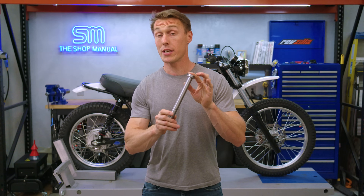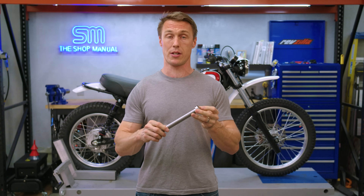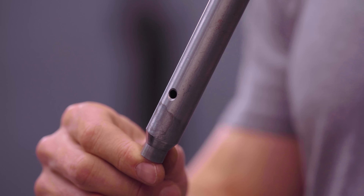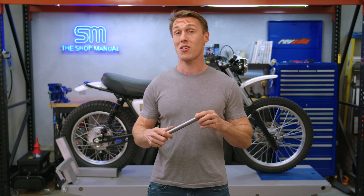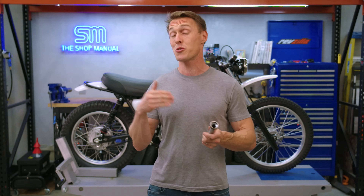This is a damper rod and it's what provides damping in the vast majority of motorcycle forks, including almost all vintage bikes, most Harleys, and many mid-level street bikes and dual sports. Damper rods rely on holes to restrict oil flow and create damping force, and therein lies the problem. Orifice-style damping is a static technology that's inherently flawed — it's mushy and soft on the brakes and while cornering, but also too harsh over sharp-edged bumps. They're sort of the worst of both worlds, and yet so many bikes have them because they're cheap to manufacture.